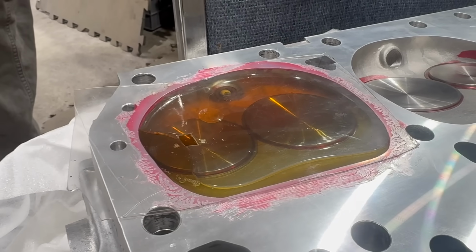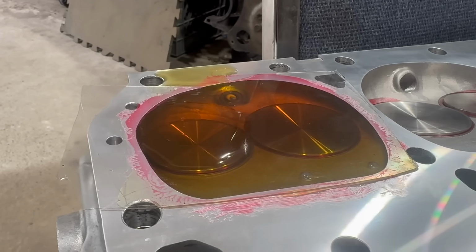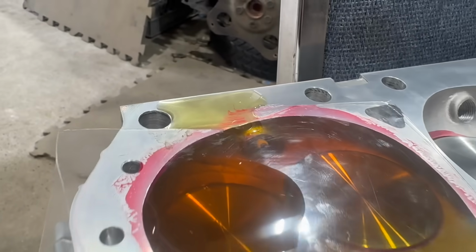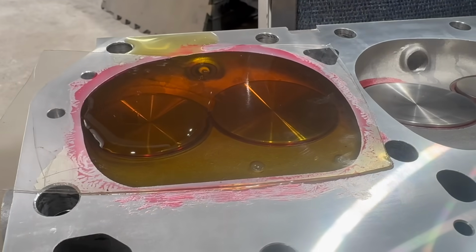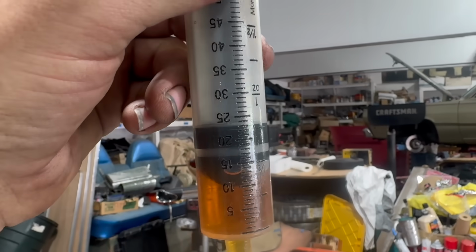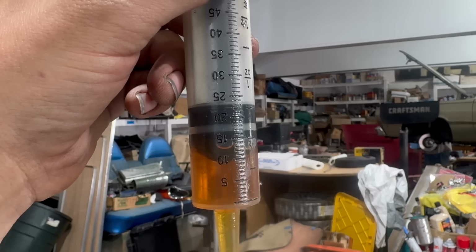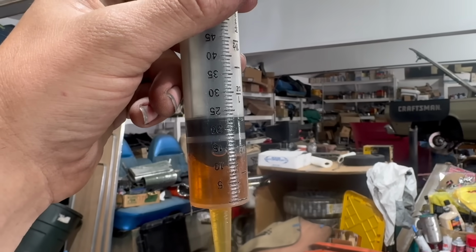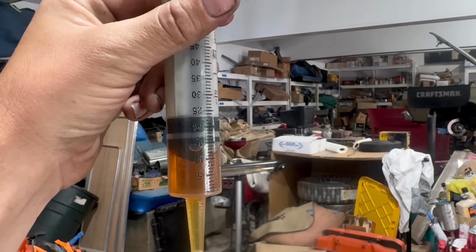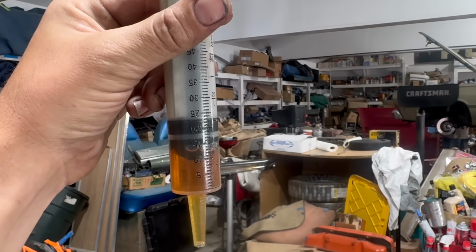There's 50 cc's in. I've got another 50 in the chamber, and we'll fill it up carefully. Okay, and now I've got it totally full. Notice my little shield didn't fully block the cylinder, and we did lose a tiny little bit at the end there. I got a large air pocket out here. There are a couple little bubbles, but I'm pretty satisfied we've got a usable number. I stopped with a sizable air pocket in there still, and we were at 78 cc's. I then fully brimmed it, and again, as you can see, it spilled out a little bit. We ended up at 85 cc's. In fact, maybe more like 86 cc's. But again, with that little bit of leakage, I'm thinking the magic number is 83, maybe even 84 cc's. That's where this chamber is going to be at.